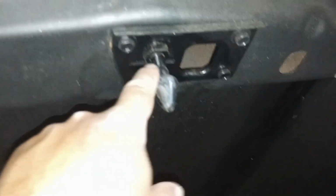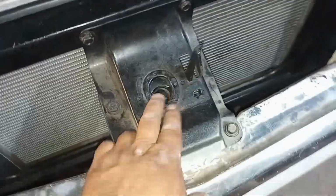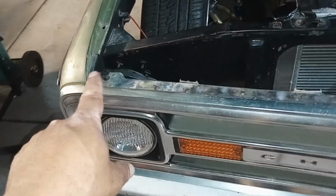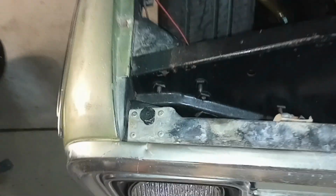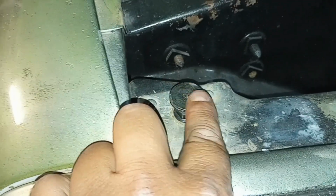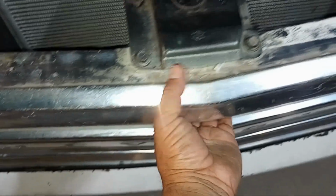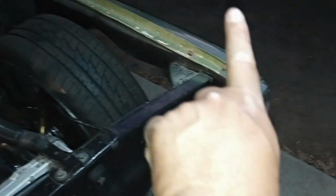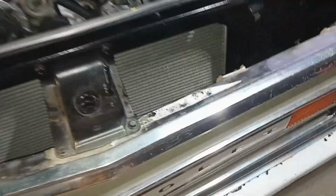And also, once you adjust this to fit in here and create a little bit of tension off of those rubber top bushings, see, this is supposed to have a little rubber on top. This one, it's already worn out, it's just metal. But it has a little half-inch rubber that goes on top. So when you push on here to release, those things push your little hood up. The little pressure helps you, pretty much just get your hand in here and the shocks do the rest.